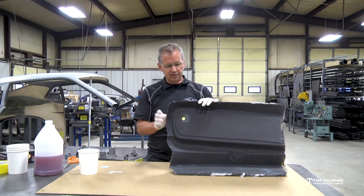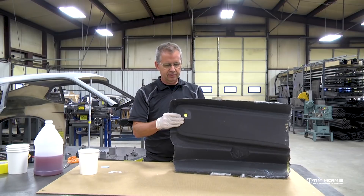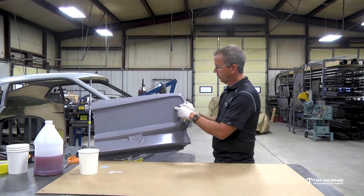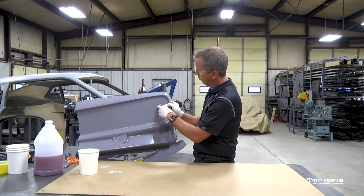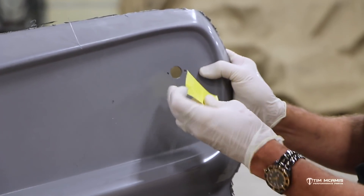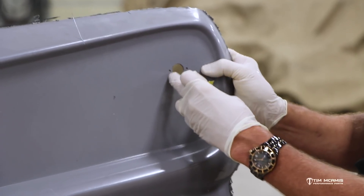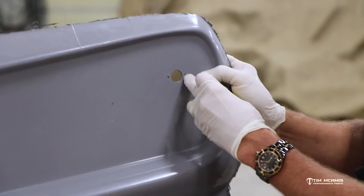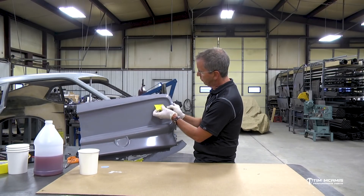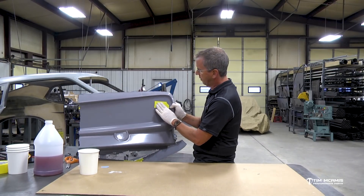The back side — and I've already put tape on the other side — so the back side of the hole is going to look something like this. I'll show you the front side without the fastener in it: you're going to have a large circular hole and then a stamped plate, and the rivet holes will be right here. What happens is over time one of these will come loose first, then inevitably the other one will come loose too. Pretty soon the fastener is loose in the hole and you're trying to put the front end back on with that thing flopping around.